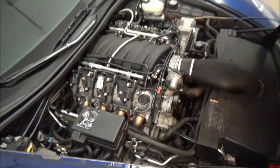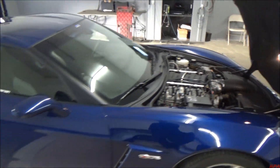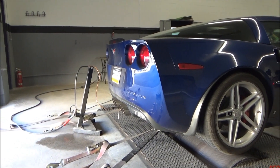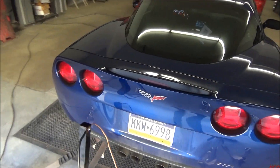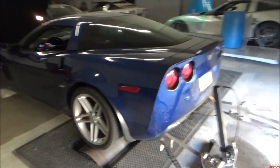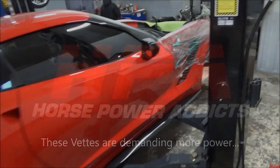Here's the American Racing Headers. It's got the Holley intake on there already. I don't believe this intake manifold is ported. This car has been around 20,000 miles. These are basically stage 2 cams, but without the mufflers it's definitely aggressive.